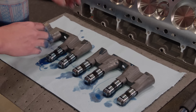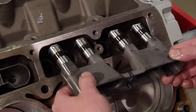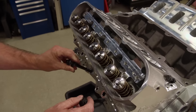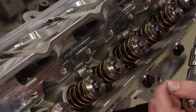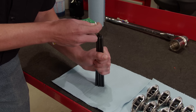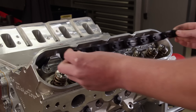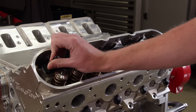The Pro-LS build continues with a set of Comp Evolution hydraulic roller lifters. These have an internal serviceable hydraulic cartridge for increased stability under load. The trays are torqued in place to 106 pound-inches. A Cometic MLS head gasket with a 4.060-inch bore and 27-thousandths compressed thickness gives us a measured compression ratio of 11.13 to 1. They are sealing up these Trick Flow Gen-X 255 LS3 cylinder heads. The ARP head bolts are torqued in three stages to a final value of 90 pound-feet, and the 8mm bolts are torqued to 25 pound-feet.